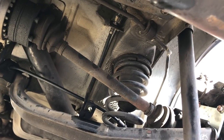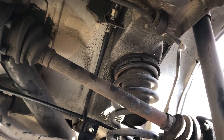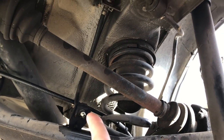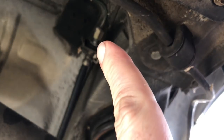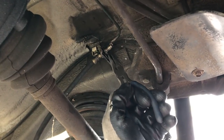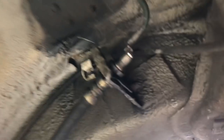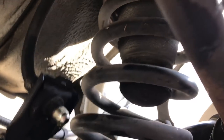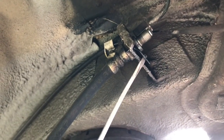Just had another one of my confused moments. When I was talking to Tim, he said the brake hose gets routed around the front of the coil spring. I'm thinking this point's backwards - but these go to there, not to there. This rubber hose gets removed. I may have been wrestling with this for about the past 20 minutes with needle-nose trying to get it out. It's a circlip - obviously not going to happen. Then I happened to glance down at this one and thought, oh, there's a hole. So if anybody else is as dim as me - screwdriver, hole, lever it down.